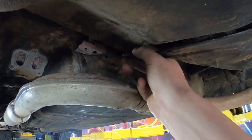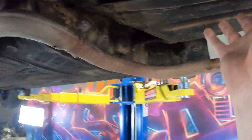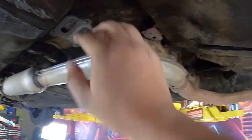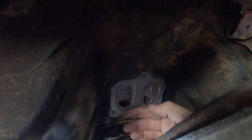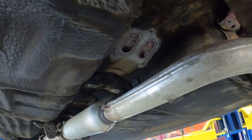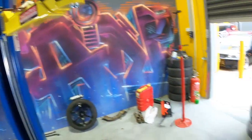But I had to take this strap out, which holds the fuel tank up, which required me to use my little helper over there, that stand. And then I could get the cable through here, which is the handbrake cable. But check out up here, this is perfectly brand new and shiny still. Everything about that looks like 1988 exactly. It's perfect. So I've gone ahead and removed both lines for the handbrake.